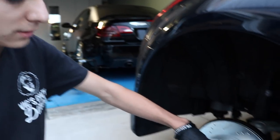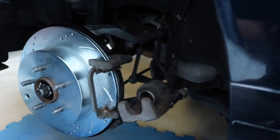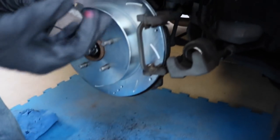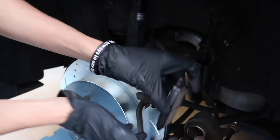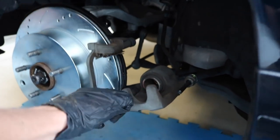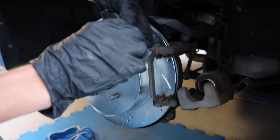As you can see we have the new rotors on and we reattached the caliper and tightened them down. In the back, loosen the top bolt so you can access the pads. So these are the new pads — what you're gonna do is get some grease and put it right there on each side. This is because while you're braking, these are gonna be under a lot of stress, so you want to make sure they're greased in there. If not, it can cause a bunch of friction, squeaking, and overheating.